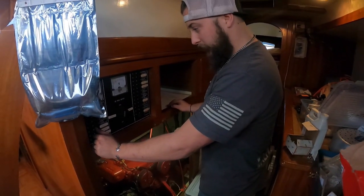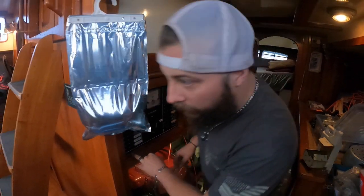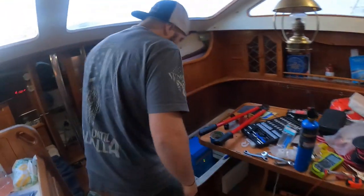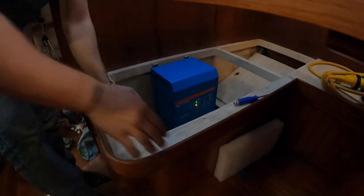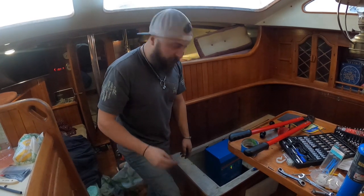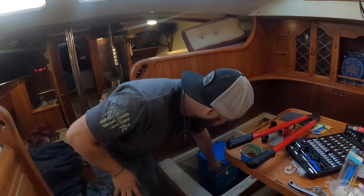So it went to pass-through mode, meaning when I send this to the panel, 110 volt comes through and we should be able to start sending stuff up. There's the 110 here turning on. Outlets on. So this is the old inverter system - it's doing nothing but being a volt meter for me right now. This would be absorption. There it goes - because those batteries are new. We've been on them for about two days, using them a little bit here and there just for lights and stereo. So it kicked on initially, went right to bulk charge, and now it's sitting there absorbing. That means it's just topping them off, and then when it floats it will just be maintaining.